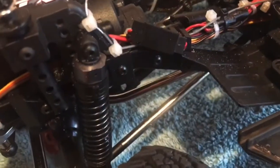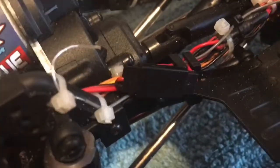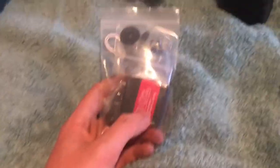Got some tools up there. First we need to — I forgot to bring the cable — we need to trace this cable into the receiver box and unplug the brown, red, and yellow cable for the servo, then unscrew it. I have got a new servo horn with servo savers; I'm not sure which one to use so I'm just going to use the normal servo horn. If it doesn't work, we'll figure something out — there's loads of screws in there but how hard can it be.